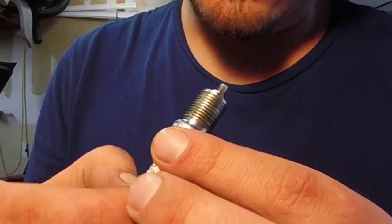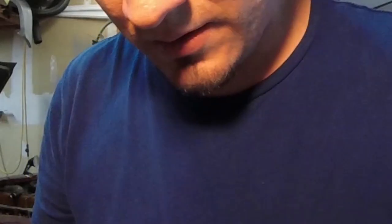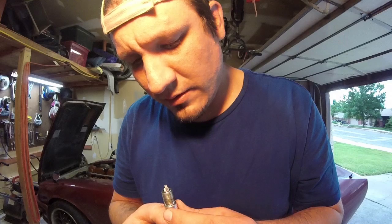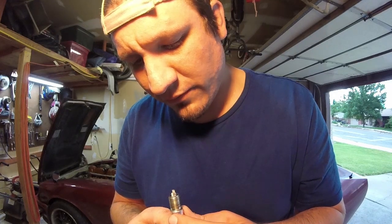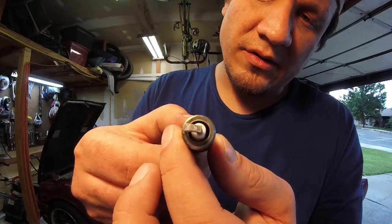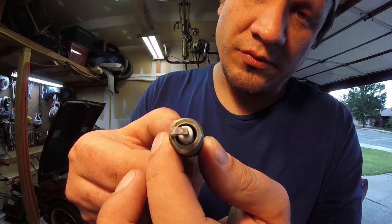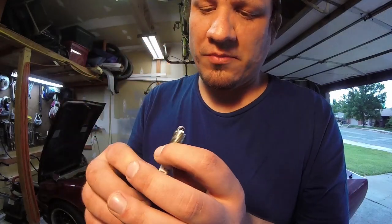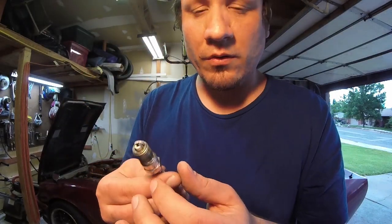It's looking great. I need to put a few more miles on it. I think my gap is about right — I'm not really noticing any real discoloration on the very tip. If I look down in there, I can start to see the richer air-fuel ratio, but I'd have to cut open the plug. Ideally, use a microscope or some type of magnifying glass to get a peek in there — that's going to give you what you're looking for.